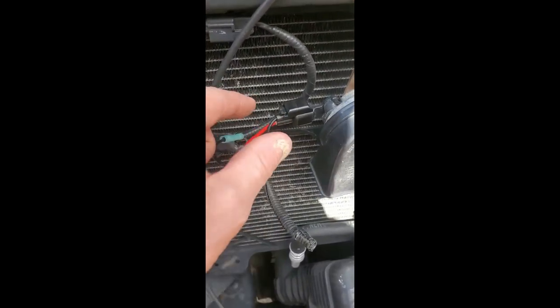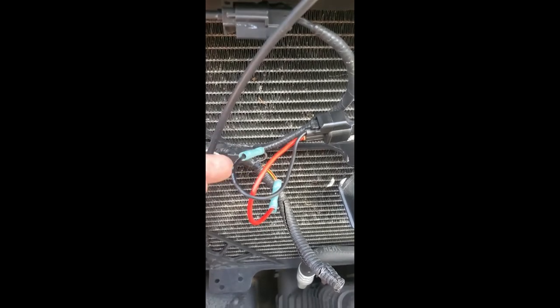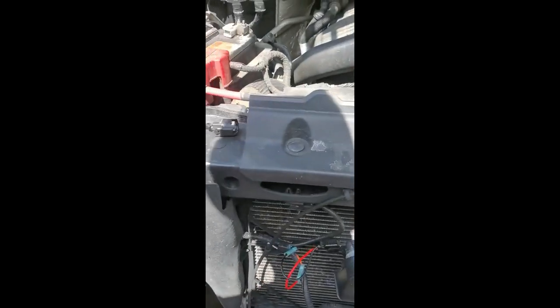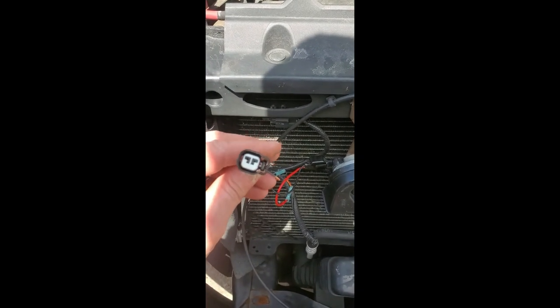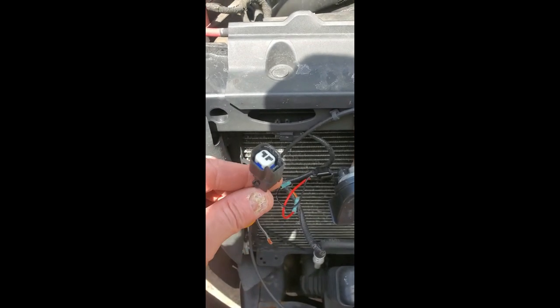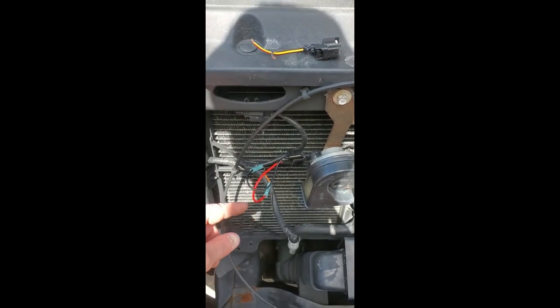So now you'll see, I just took that Molex connector, positive to negative, hooked it up right there. I'll heat shrink it and wrap it back up in the plastic outer casing that came with it. But now, good as new. Like I said, you'll find some of the forums, it's pretty elaborate, but it actually was the factory connector itself that was bad. When I tested it, there was no power getting to it. So I assumed it was somewhere between the BCM and here. I didn't even give a thought to the actual connector itself. So do some really good troubleshooting and save yourself a lot of scratch. And, you know, be good. So I'm just going to clean this up and we'll be good to go.